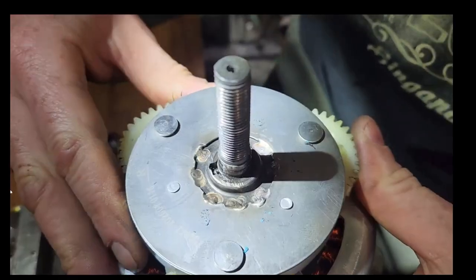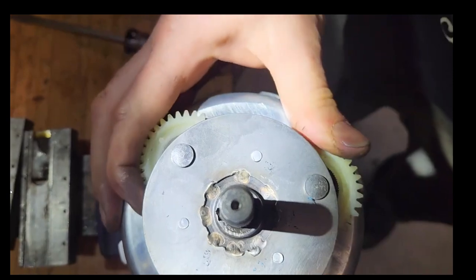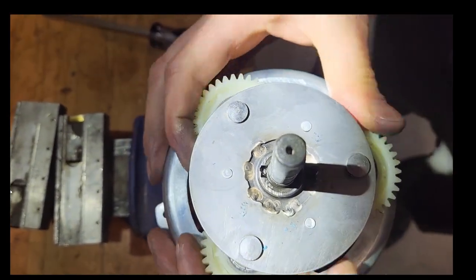It's now been a little over four months since we filmed that video on locking the clutches in geared motors to achieve regen, and I wanted to address the issue of planet carriers being able to rock back and forth. In some motors, especially those with fairly small diameter axles, there's quite substantial torque on that keyway. While riding, you notice a little bit of play every time you switch between accelerating and doing regen — a little thunk or clicking sound. If regen intensity is too strong, that can worsen over time to the point where the planet carrier has substantial back-and-forth motion and you risk metal shearing off and breaking inside the motor.